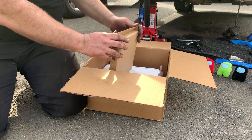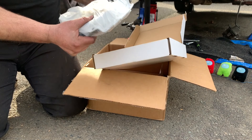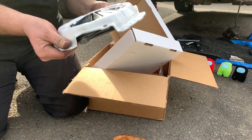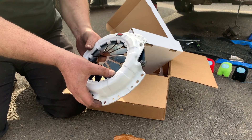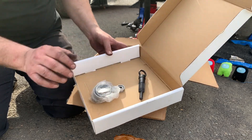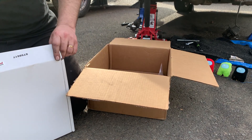We will see how this clutch holds up with first-time teenage drivers. This is the pressure plate, which looks pretty close to the one that was in there — so maybe we will destroy this one too, I hope not. It should last a while. Let's check that number: ST98617. And of course there's a new throwout bearing, clutch alignment tool, and a pilot bearing — though these cars don't have a pilot bearing, which is kind of weird.